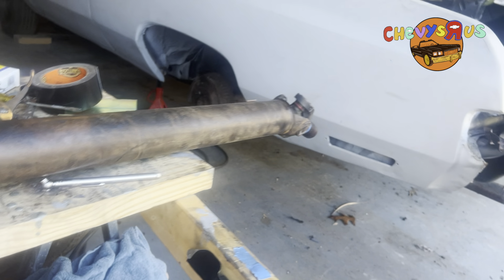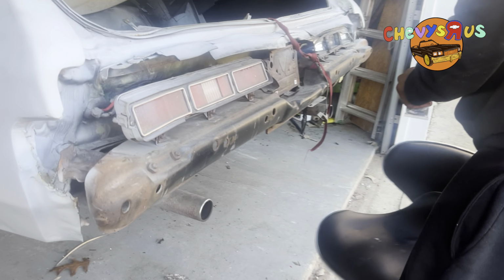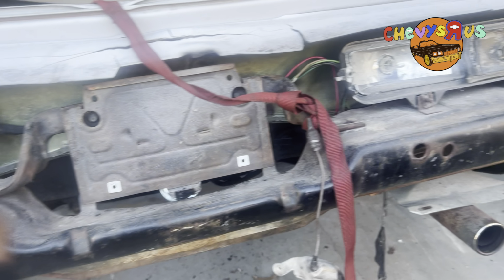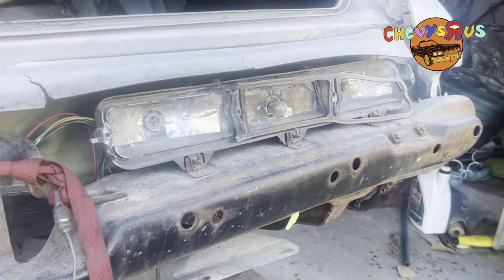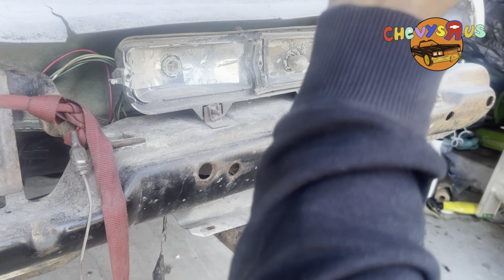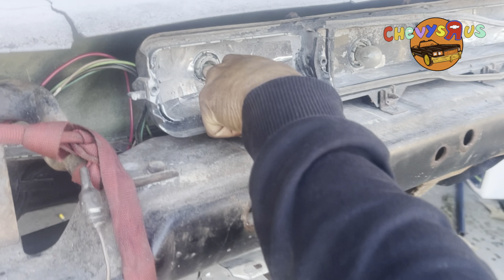But while we're waiting, I've just been doing little stuff. As y'all can see, working on the back lights, right here, not in the trunk, these back lights. I actually got all the back lights working. What I did is I used the process of elimination for the tail lights. I cut the power on and I tested here and I wasn't getting no power here.